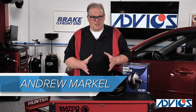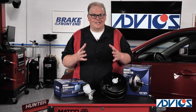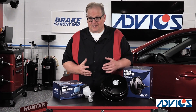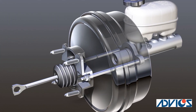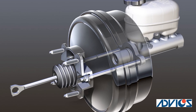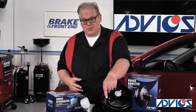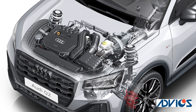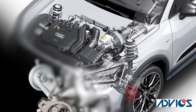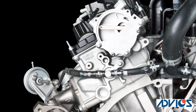Okay, here's the situation. You've got a vehicle in your bay and you notice that the brake booster is not working — that's the customer's complaint also. It's a hard brake pedal, and you look inside the brake booster and you notice oil. But then you start following that line from the brake booster to the engine and you notice it's not connected to the intake manifold, but instead it's connected to a round cylinder on the exhaust camshaft cylinder head.